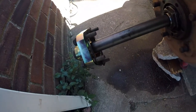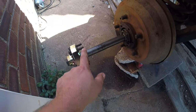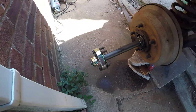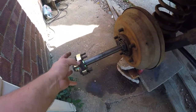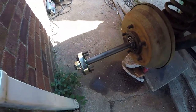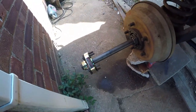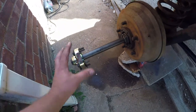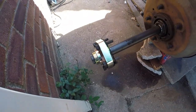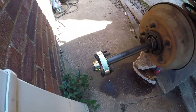What I've done is put the bolt through the gasket like so, all ready to be lined up. Now like this I can put a little bit of Loctite on these without worrying about it getting on the flange or on the gasket or anywhere else — nice and easy. Then when they've got Loctite on them, slide the whole thing in. While it's out I've had a little inspection of the shaft — unfortunately I can't get it all out because there's a building in the way — but there's no backlash or anything like that, so nothing to stress about. I'll be putting an o-ring and circlip on there, then this side will be done.